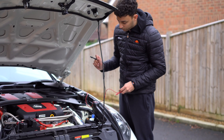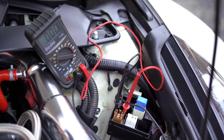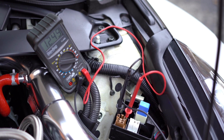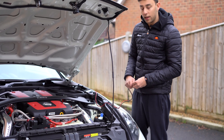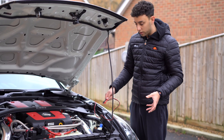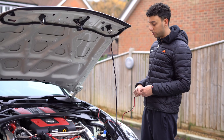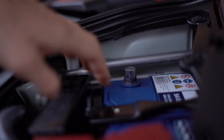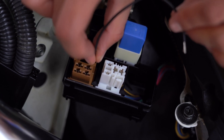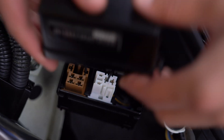If we measure across the heated seat relay we'd see 0 volts, but when we turn the car on we'll see 12 volts. The idea is to bridge the wire from the plus 12 from the heated seat relay over to our DRL relay, and therefore we get lights on all the time. You might be thinking - are they not going to be on all the time? No, because the heated seat relay is only active when the car is on. First, disconnect the battery. Then get your piece of wire and slot it into the plus 12 terminal and the ground in the DRL relay, and pop the lid back on.